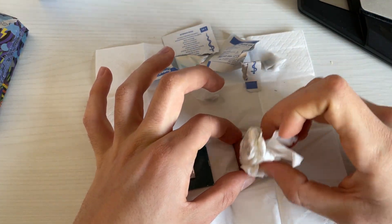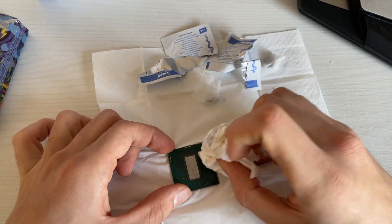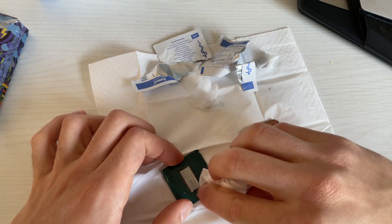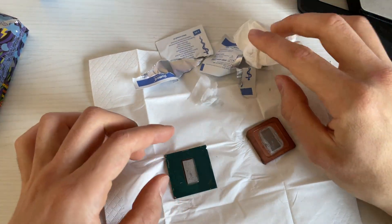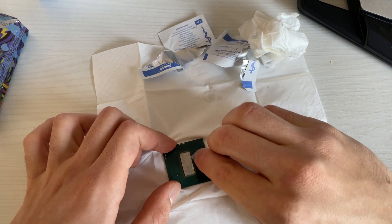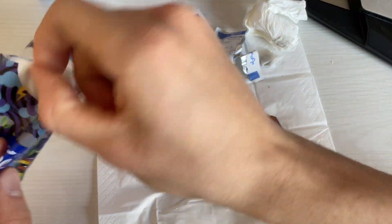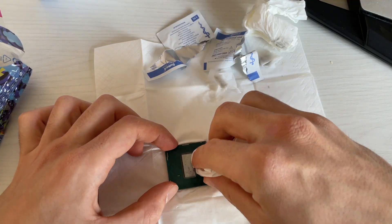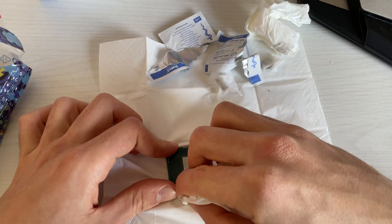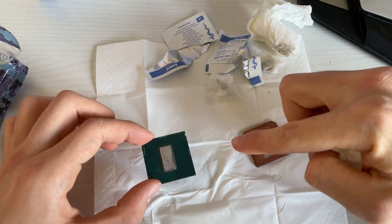Okay, now let me finish drying off the die. That's very bad — I was actually spreading liquid metal over here, and if you do that you will kill your CPU. I'll use alcohol wipes to get it off completely. Be very careful when using tissues with liquid metal not to touch the conductive parts of the CPU — the SMDs — because that's going to kill it.